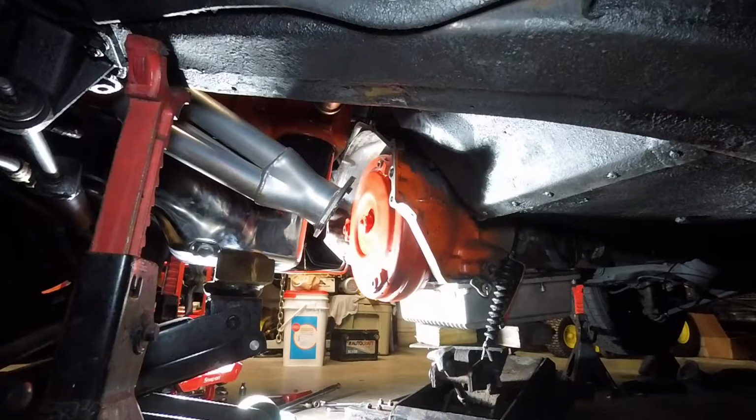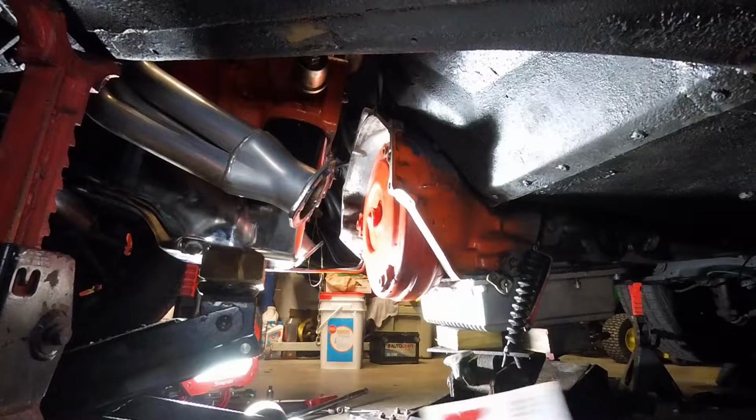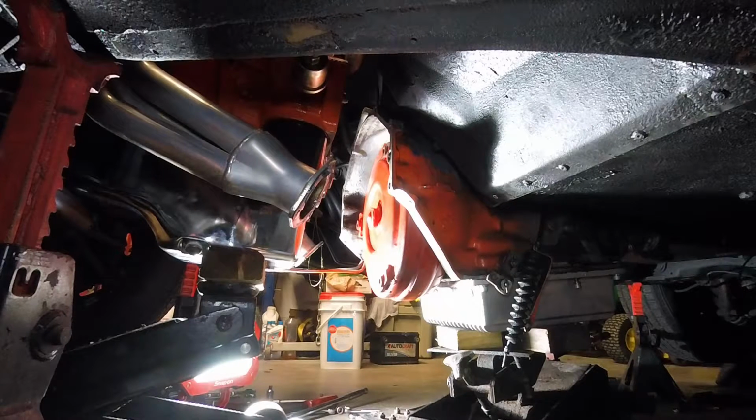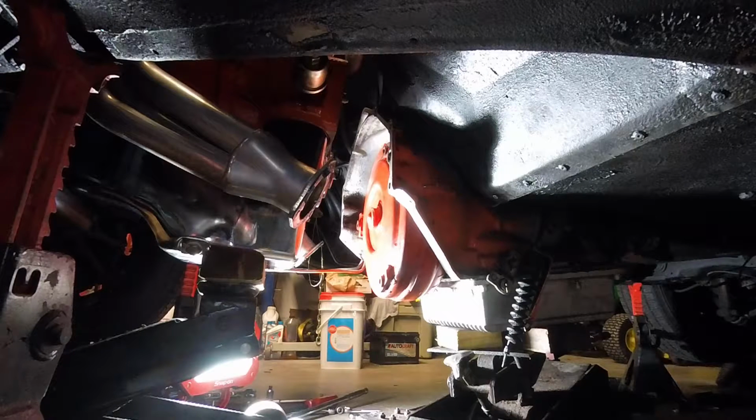All right. So we've got some nice ARP bolts. And they have specific instructions, such as do not use any washers, check the part numbers, use red Loctite and the enclosed fastener assembly lubricant, and then torque to 85 pound-feet using the specified lubricants in step 4. Install the flex plate onto the crankshaft and tighten the bolts by hand using an alternating crisscross pattern. Torque the bolts to 85 foot-pounds using the specified lubricants. Easy day. This side must face the engine.